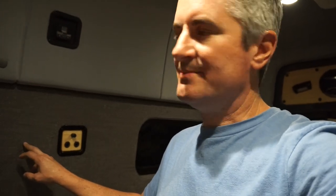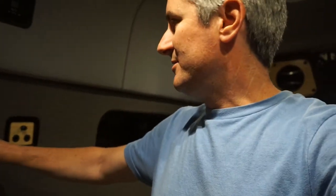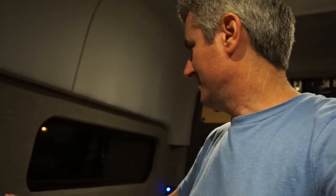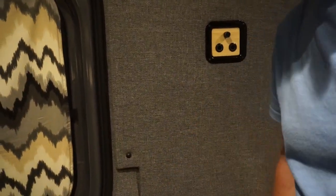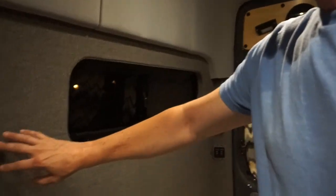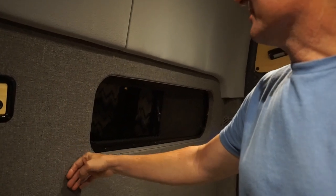One thing to note is I read some varying things about using 3M90 on your walls. I guess the 3M spray adhesive works well for really small panels, but I've been told that for really large panels like these, the glue eventually doesn't stick. So I use 3M90 for gluing these small sections straight to the metal, and I get the impression that that's all right, but I basically found out that it's not so good to do it on large panels like this.